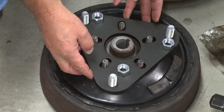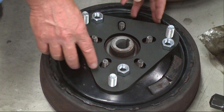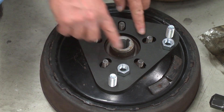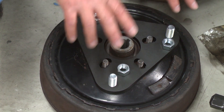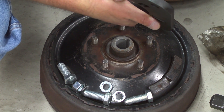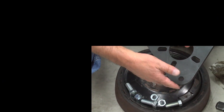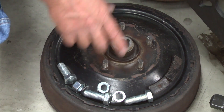For those working with vintage cars that have smaller bolt circles than five-on-five-and-a-half, this adapter plate from OTC — the 6574-1 — enables bolting the plate to the OEM studs for the hub wheel assembly and using these bolts to the three legs of the hub puller. With this heavy-duty 6574-1 adapter plate, you can use the 7394 hub puller to remove the hub and drum assembly on vehicles with smaller bolt circles.